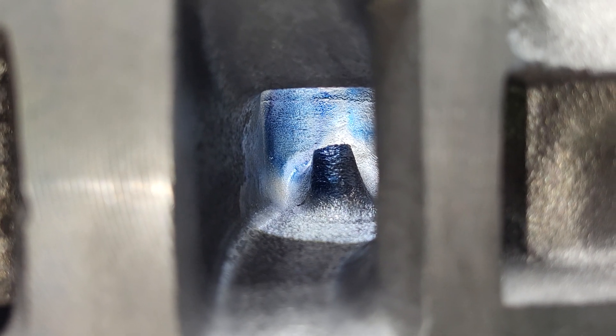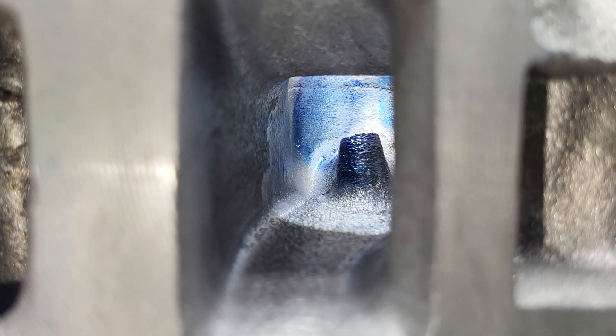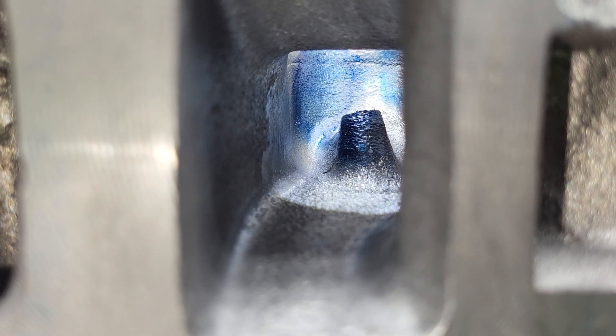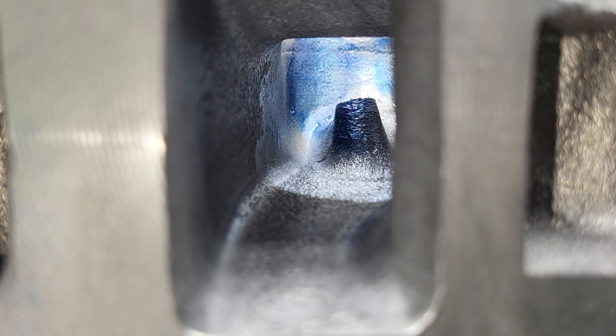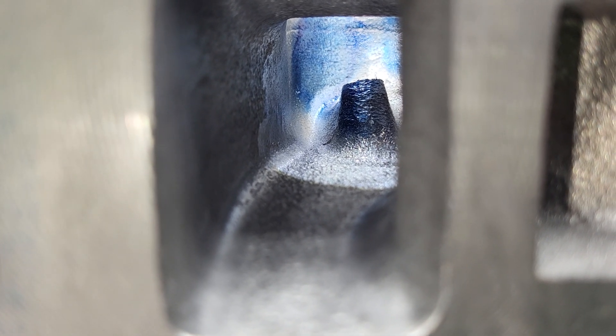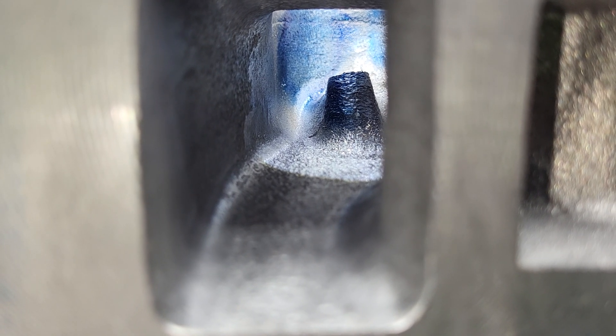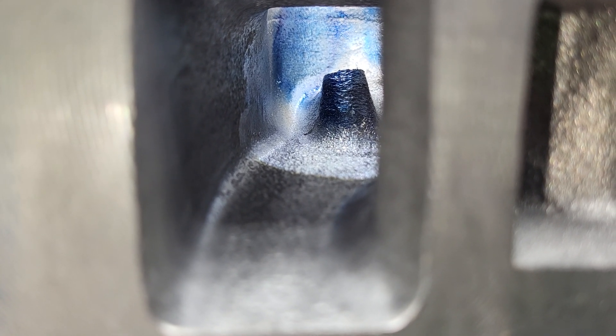The back of that bowl looks quite good — really nice coverage. The left side of that bowl has been brought over towards the center because there was a big kick in it. You can still see the line for the light on the roof has a kick in it. I'm not sure how much of that I can take out. I have to really measure it, and it doesn't make any sense to go overboard on one port if I can't reproduce it on all the others. I need to keep that in mind.